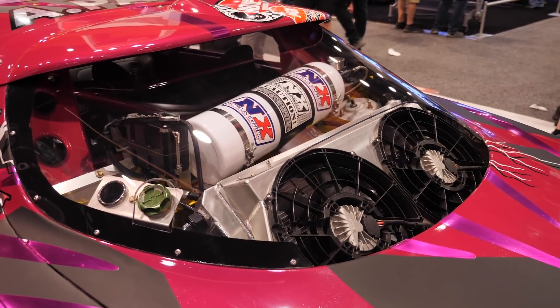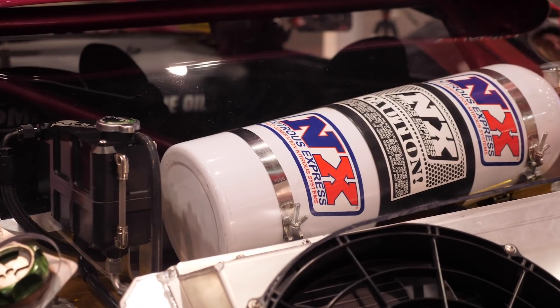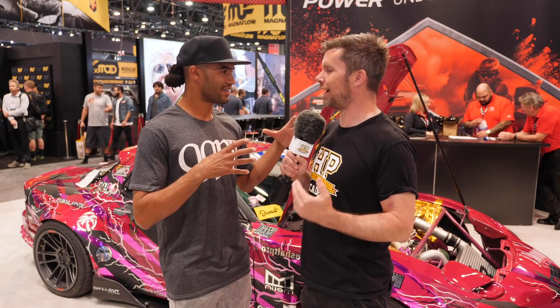The car is also set up with a nitrous system, currently not running. It's being used to fill in the gaps of having a small-displacement engine. It's set up on TPS and throttle parameters — activating at 80-100% throttle, only between three and four thousand RPM. That window of nitrous operation helps get the turbo online so it can do its thing for the rest of the power band. Essentially it's being used as a form of anti-lag — instant low-end boost response to fill in the low-RPM torque hole.